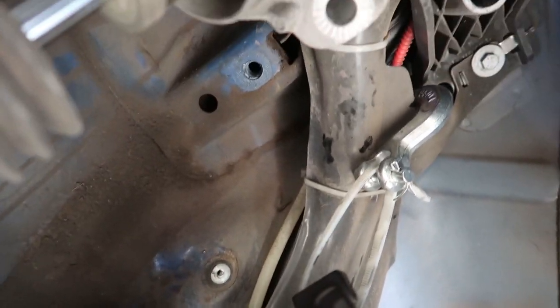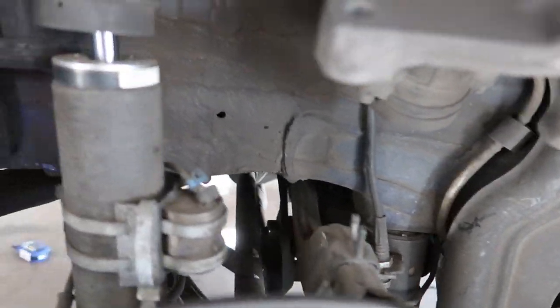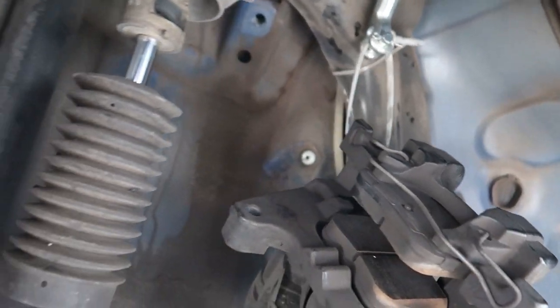If you're doing any of this stuff, just make sure you're replacing hardware. I did reuse axle bolts before and they did get loose - not the axle-axle bolts but this main center bolt. A lot of this stuff is one-time use: the M16 triple-square trailing arm bolts, axle bolts, driveshaft bolts, subframe bolts. I'm also going to replace the trailing arm bolts. I grabbed some hooks from Harbor Freight, sticked it right there, zip-tied right on the brake - everything's out of the way. Nice.